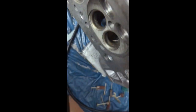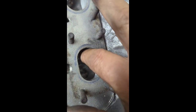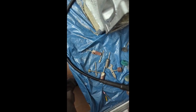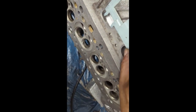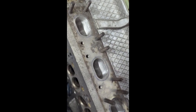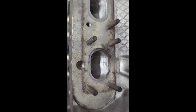I finished sanding with the sanding wheel. Where do you start, where do you stop? I think I've now uniformly gotten every piece where I used the carbide bit and smoothed it up more. The next step — the final one — is just using these flapper thingies in different grits to get a smoother finish. I do have a gasket matching mark I made with the exhaust gasket, but I'm not going to go that far. I check to see if I took off too much and if it's even somewhat across the ports. It's all manual, it's not going to be 100% perfect, but close enough — you just have to know when to stop.